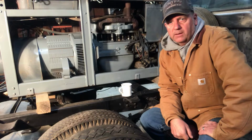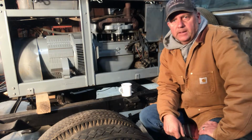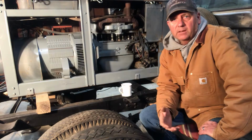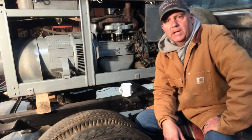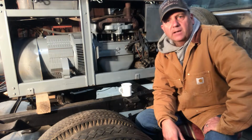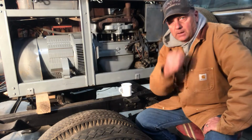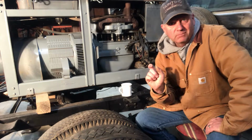Almost no power, had to do a lot of cleaning in the generator area. Then when we got some leads and put a load on it, it would bog down, and I couldn't figure out why. Thought I'd checked everything, apparently not. So started seeking for some advice, looking at manuals, and seemed that people were saying maybe didn't get enough fire. So new plugs, new wires, checked the cap, cleaned it. The magneto seemed to be, half-inch blue spark.